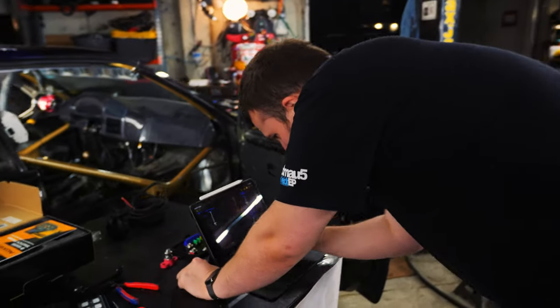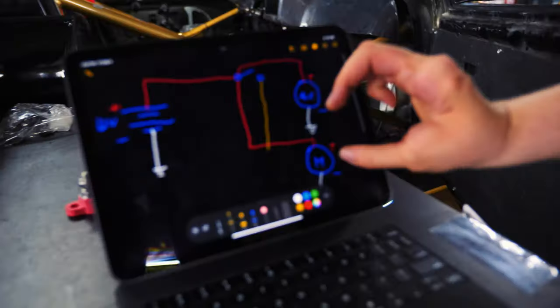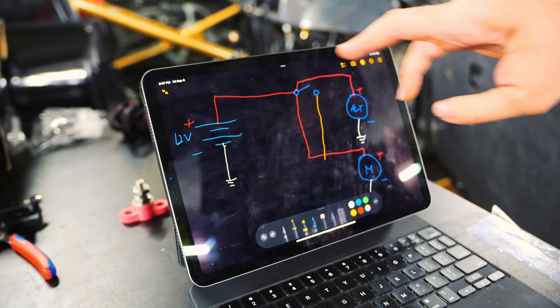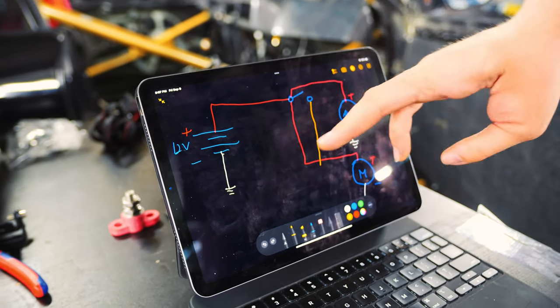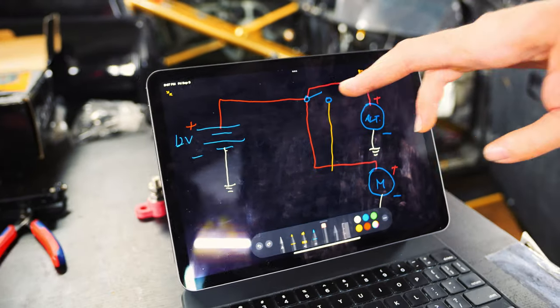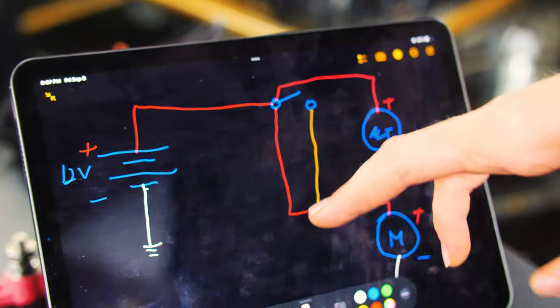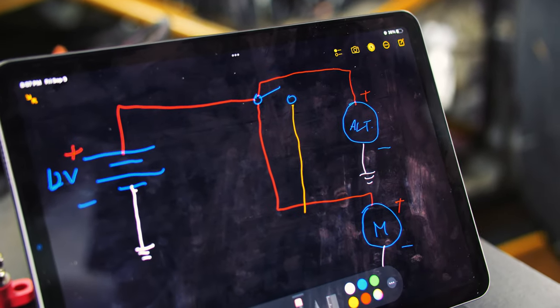Okay Tanner, what are we working on? Shutting off your ECU and everything — making sure when you disconnect it, it actually stays disconnected. So you have your battery over here going to your kill switch. Your alternator is directly connected along with your starter. But when you close this switch, the yellow wire is your protected power. When you disconnect that in an emergency, you disconnect the only path back to the battery for all the special electronics running the engine.